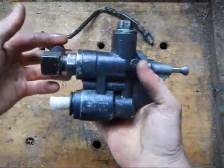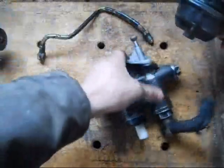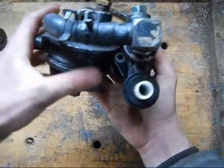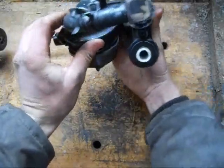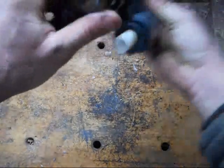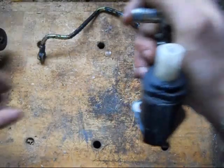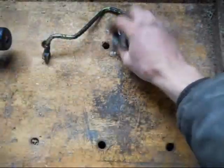Okay, here you are — you got your lines here. This guy happens to be hand tight. Now you got this fuel line here; it actually goes over to the fuel heater. The fuel heater normally has a barb right here, but I used it for something. So then you just pull that guy off like that — you have to grab the clamps and pull them to slide back. It's going to take a bit of motivating. This guy has the screws — that is half-inch NPT. Keep all these parts in view.